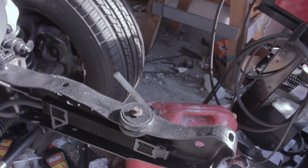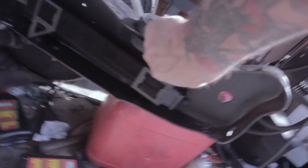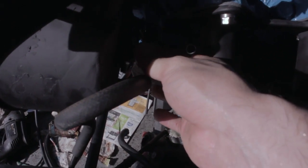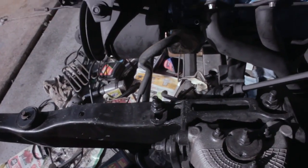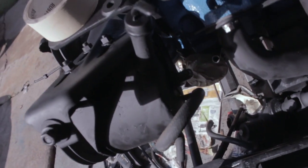Something else that Dad managed to accomplish despite the intense heat was mounting this new power steering cooler. This was a transmission cooler from a heavy duty work truck — bent the ears around. It's mounted at kind of an angle so that this screw here doesn't hit the blade, so you might have to put it down at an angle if you have one like ours. The hoses look right in here. For the higher pressure line, we'll have to have something that connects from the threaded part of the back of the pump down into the rack on the Crown Vic. Unfortunately, I lost the hose that went to this pump originally — I think I might have accidentally sold it with the gearbox — and the fitting on the line coming out of here was broken. So I'm going to have to talk to an auto parts store about getting one made, and I'll do a video about how that works out.